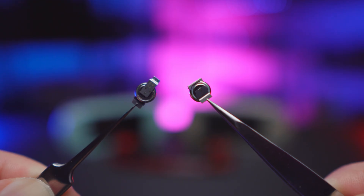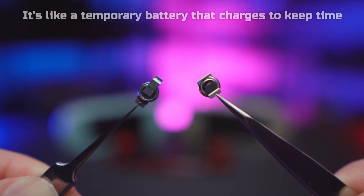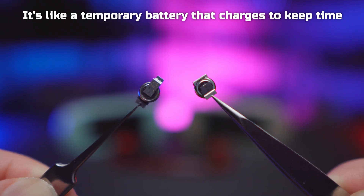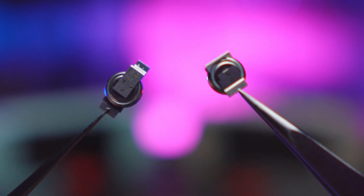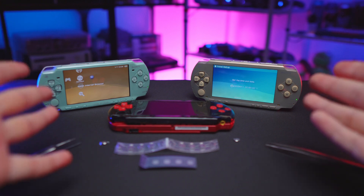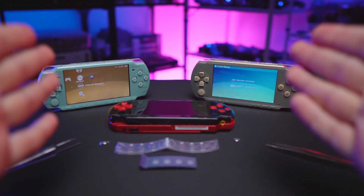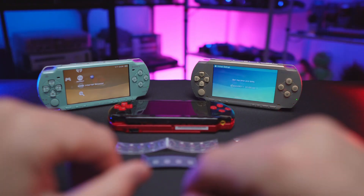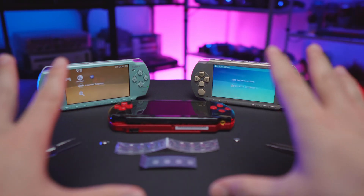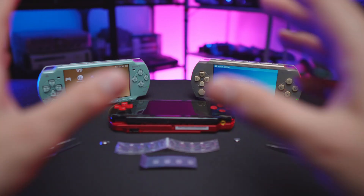For the first problem of setting up your date every time you remove the battery, that is fixed by replacing the supercapacitor, which is commonly mistaken as the CMOS battery but really is just a supercapacitor that charges up when you have power flowing through the PSP. For the other two fixes, you can either do the same thing or simply just remove them. You can just remove them if you're having some weird battery drain issues, or to fix weird power issues where your PSP is not turning on at times, which usually happens with PSP 3000 models. An old defective clock capacitor is a common point of failure if you ever encounter those issues.